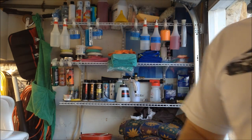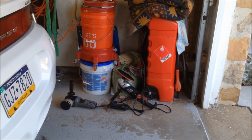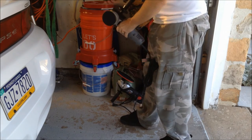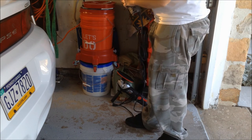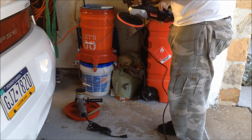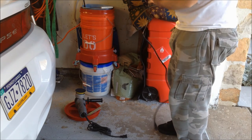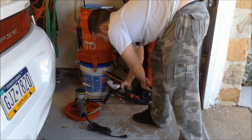On the far left is my dual action polisher, the Porter Cable 7424XP. It has a 3-inch pad on it, and I also have the standard 5-inch pad. I like the 3-inch for doing headlights — the last thing I did was a set of headlights. This is my rotary — just got it, it's a Harbor Freight special. I can't really recommend it; the RPMs fluctuate a little too much and it's quite annoying. I've only used it one time so I wasn't really trying to spend $150 on a good one.